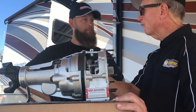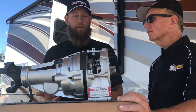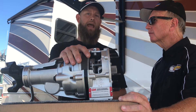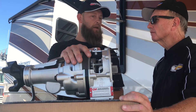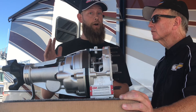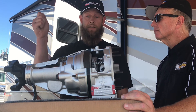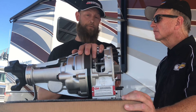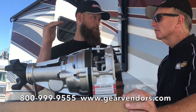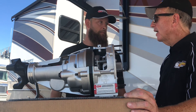On the big power stuff, how are they using it? It's used a little differently depending on the power level. A lot of big power guys run it and they're just using it for the highway, because they don't need the close ratios going down the track. The 500 horsepower kind of average guy is going to launch in first, grab overdrive for one and a half, second, second and a half — split those gears, get closer ratios, less RPM drop — and that'll make it quicker. That's the power.